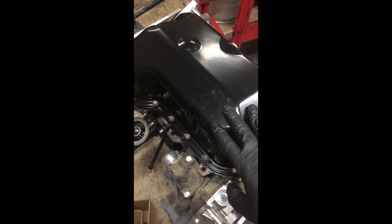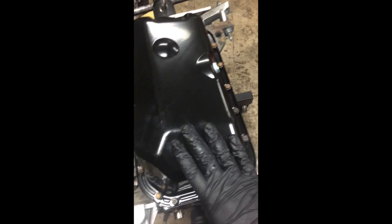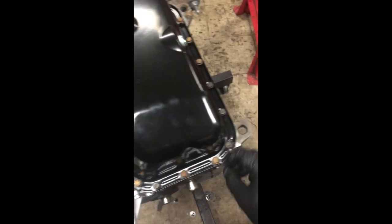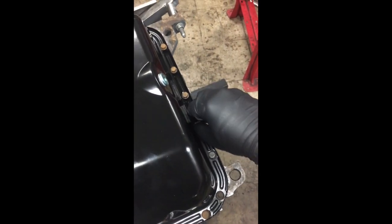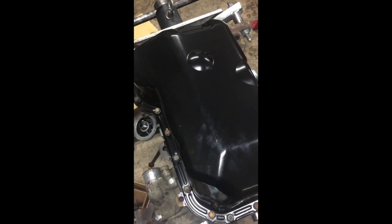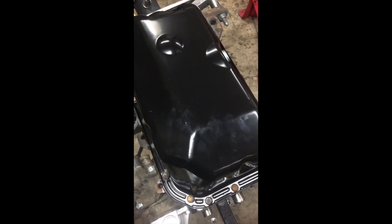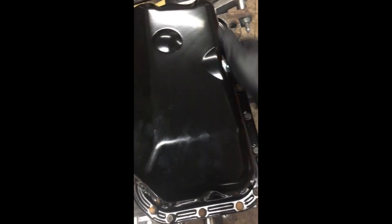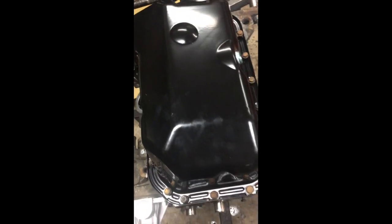It's very important to make sure you're paying attention to torque specs and that everything is nice and clean before putting on fresh gaskets. If you're replacing a gasket, obviously you've got a leak, so you don't want it to leak anymore. We're going to torque this to 15 foot-pounds, wait 5 minutes, then torque it again. I'm probably going to do a criss-cross pattern on this to make sure it cinches down evenly so we don't have it binding or end up with some weird deformity.